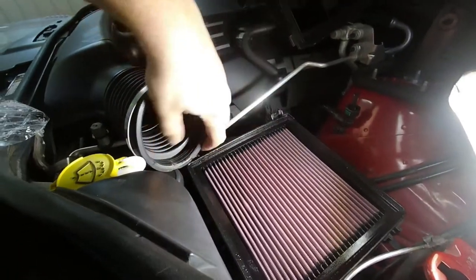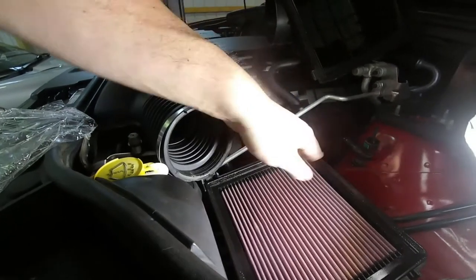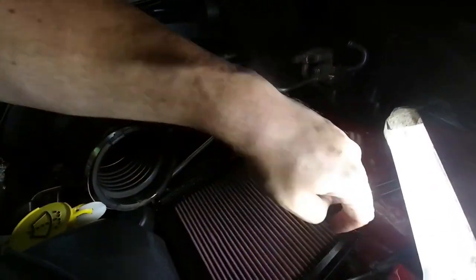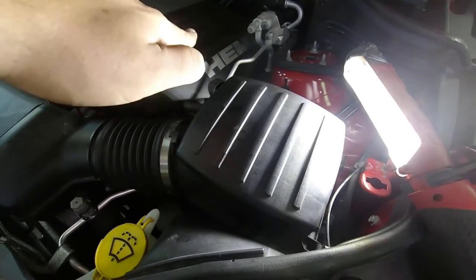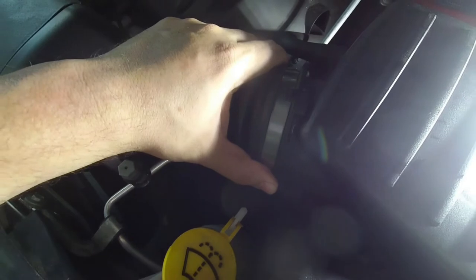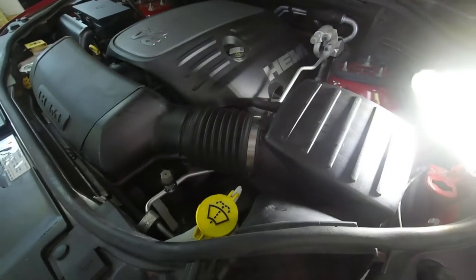You see here are the little hinges I was talking about. When this goes on, make sure that the box goes down under these hinges. Close it and then flip up your tabs again. So just reverse everything you did to get it back together: put your tabs under the hinges in the back, close it, do your locks in the front, and refit the air hose. I had to work the bottom a little bit to get it back on, then tighten down the clamp. It's good and solid. And that's it for the air filter.